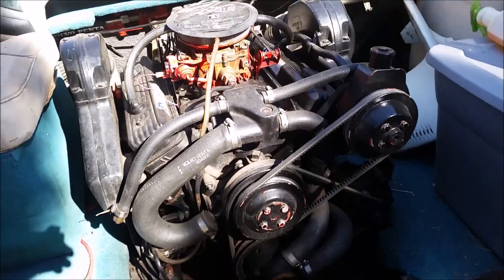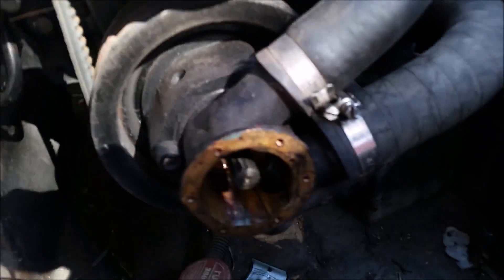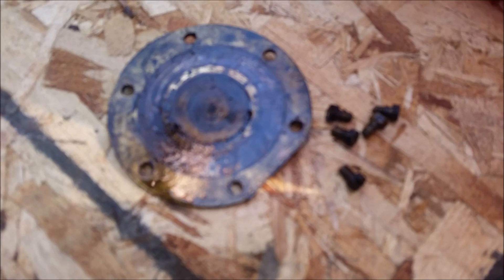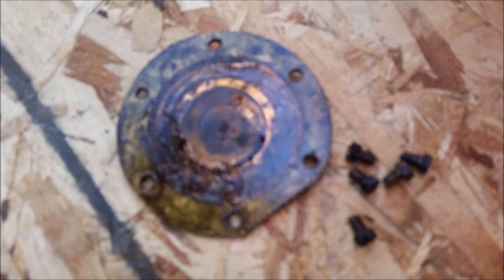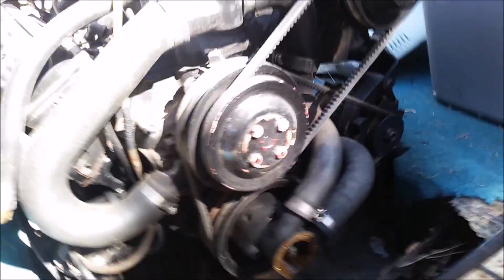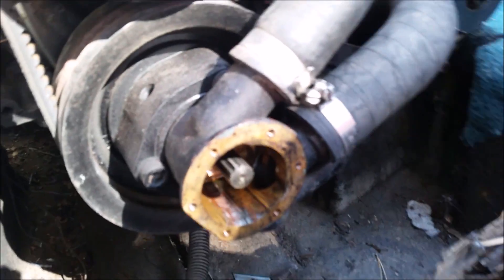Change the water pump — it's pretty simple. The pump is located here. I've already taken the cover off, and the cover is right there. All you do is undo the six bolts that are holding it in. I was able to pull mine out pretty easily. There's a special puller you can buy, but I don't think it's worth it because if you're replacing it, you don't mind destroying it in the first place.